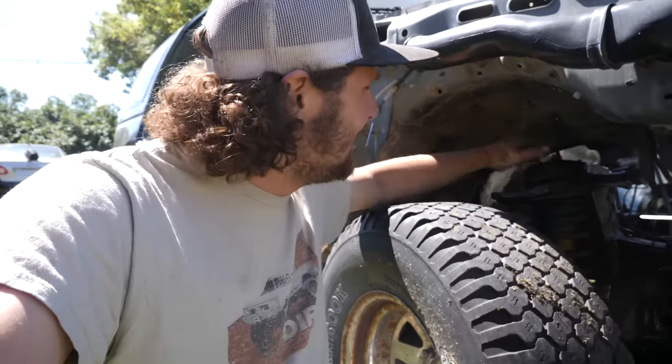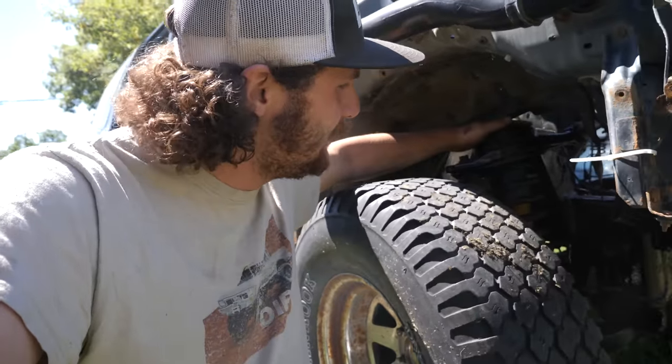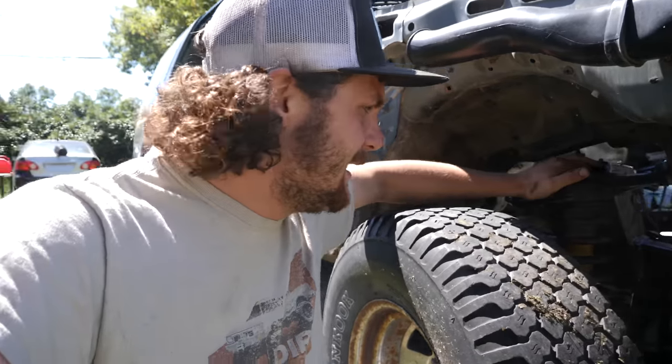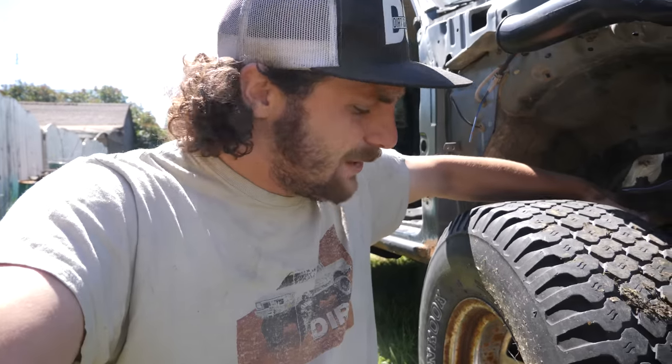So now that I've got the Tundra struts in place, I kind of just want to finish off the front suspension here. So that means pulling it back apart, pulling the spindle out, putting in the new upper and lower ball joints, throwing the CV axles in. I'm gonna paint the spindles, make sure they look nice and pretty as well. Put the rotors on, put the calipers on. The calipers also need a coat of paint. And yeah, just finish off this front suspension.